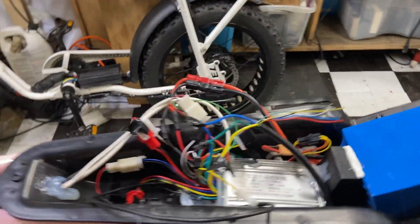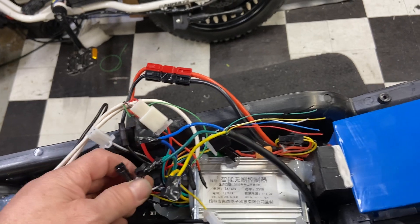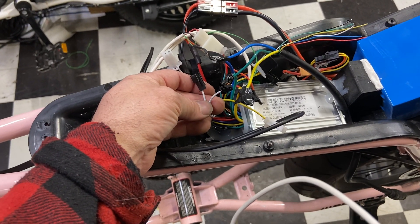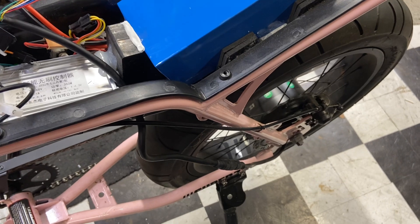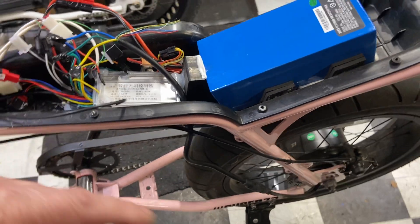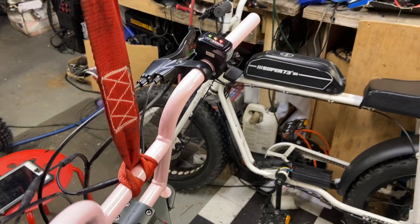One more thing on your self-learning wire. When you plug these controllers in, you have to have the chain removed and the wheel suspended up in the air, because these white wires that come on these aftermarket non-programmable controllers engage full throttle during self-learning. You have to do it with the chain off so the pedals don't spin backwards and hit your shin. When you plug them in the wheel's going to spin — if it goes in reverse, just unplug it, wait for the wheel to stop spinning, and plug it in again. When the wheel starts to spin forward, you can unplug it and that's it. Then you can hit the brake, test your throttle, and everything works as it should.